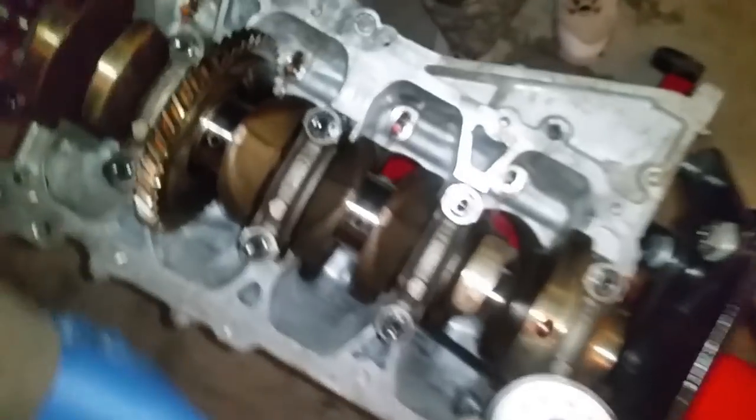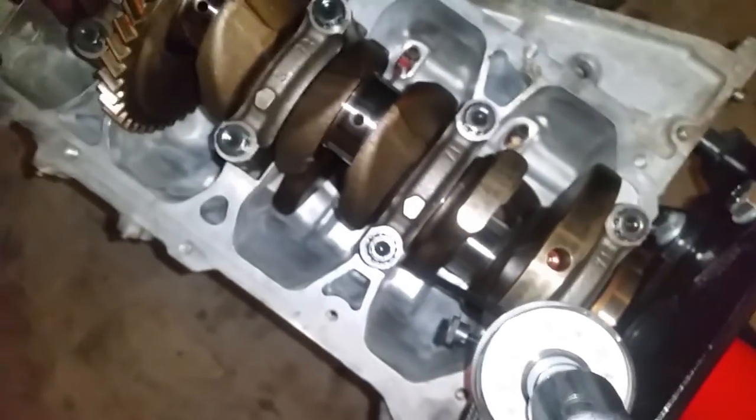your intent. So now no torque wrench is needed because now you're just doing the degree turn. Had I used a torque wrench, it would just click and there would be no point of it clicking because it's not reading. I'm trying to do this on camera with one hand, so I apologize if it gets a little jumpy. Okay, I have it again lined up and here I go, one-handed. Hopefully it doesn't slip off. I have to put my hand here, so I apologize because I really don't want it to slip off. Okay, that's 90 degrees right there, and that bolt has been torqued to 30 foot-pounds and also 90 degrees.